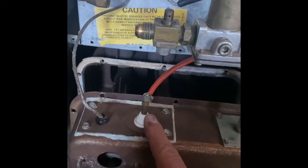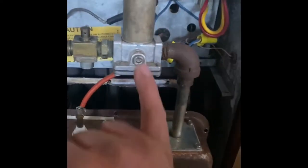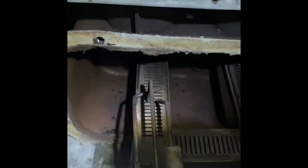So here's the ignition — flame sensor, thermocouple, something like that — and the gas valve. You can see the burners with the little slits, a little three-piece set with a cross section. This is the electrode assembly. The spark goes from that far right one to the middle. There's some corrosion on it which I'm going to clean off. I was observing the distance between them carefully and it seems like they could be spread a little further apart, which would create a bigger spark and give the gas a better chance to ignite.